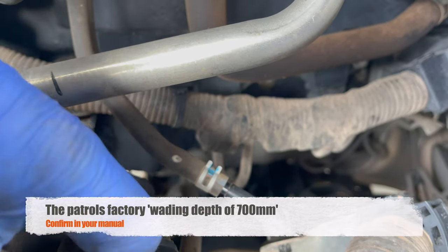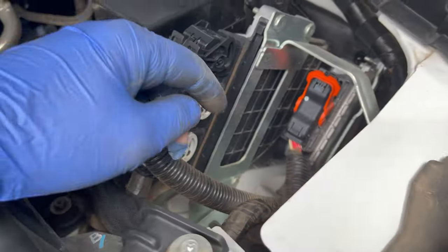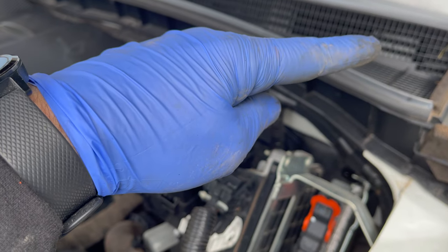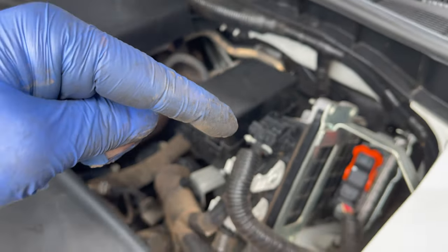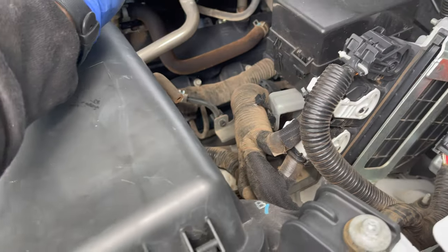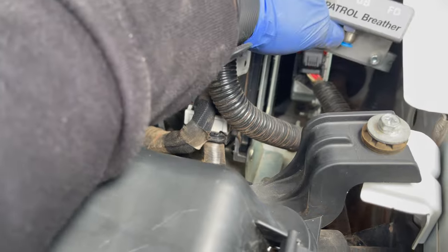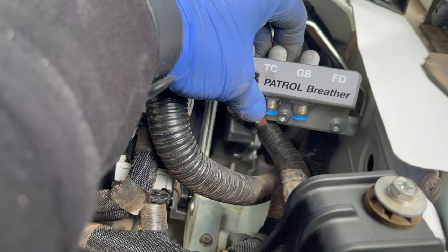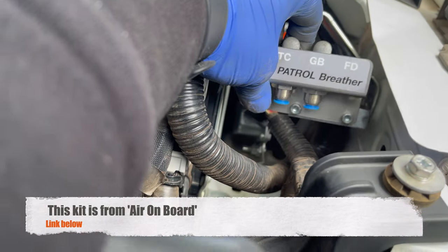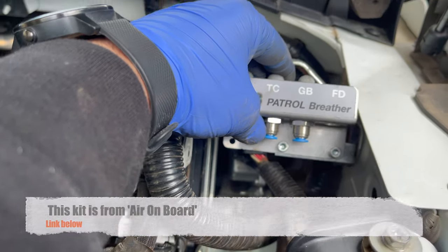This pipe goes all the way down to the front diff and across into the breather, so keeping it fairly central to this part especially. The back diff also comes up onto the filler side, and I'm going to run the new hose all the way down up into the engine bay and probably bring it up where that front diff breather comes up as well. There's a bolt holding this ECU bracket on the side here — I'm going to bolt my bracket just up here, and then I can bring the tubes up nice and easily.